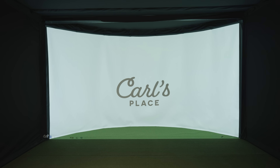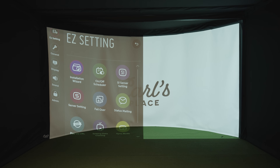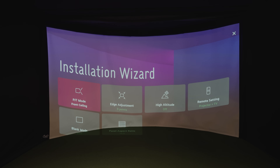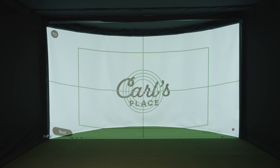The projector we're using today is the LG Probeam BU53RG, and it's got a really easy way to do that. The first thing you do is click the settings button on the remote, then under 'Easy Settings' go to the 'Installation Wizard.' In the installation wizard, look for the edge adjustment. In here you can adjust either 4, 9, 15, or 25 points. We found it's easiest just to do the 9-point adjustment, so we're going to select that. Then all you do is go through and select the different points on the screen that you want to adjust.